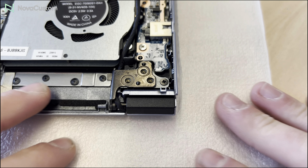Take the new screen and place it in front of you. Then you can take the palm rest part again and put it back the same way. Make sure that you put the cables back properly along the hinge.